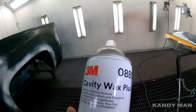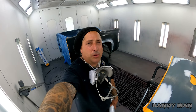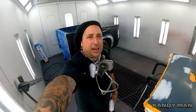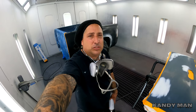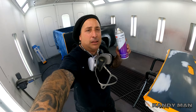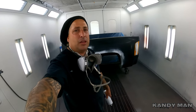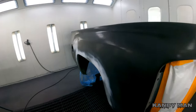This cavity wax is very good stuff. That's what kept my Cutlass alive for all those years without rusting — that car was rust-proofed from the factory, and I had to replace all the plugs when I did that candy paint job on it. So make sure you treat your bare weld areas with paint, and after it's painted treat them with the cavity wax to make sure it lasts a long time. We'll shoot this one, get all the welds done and show you the finished result.